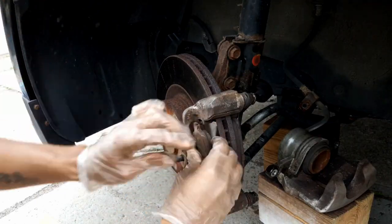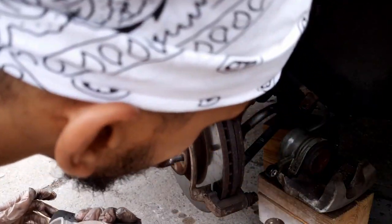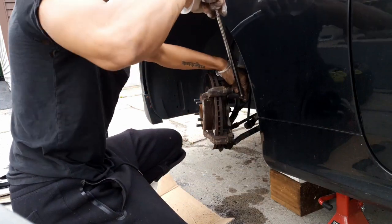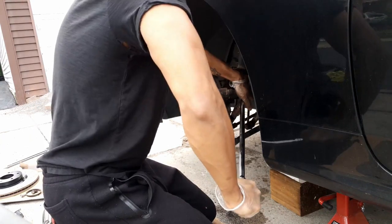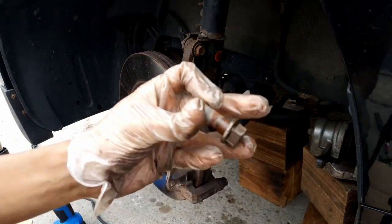Just take a little pick at it, try to be gentle and take it out. Then finally you want to take your hammer and bang the backplate, because this is seized on — this is what four years of neglect looks like. Grab your 17mm bolt and you're gonna struggle exactly like I did, switching through PB Blaster, breaker bar, and hammer. Eventually I pulled out the impact driver and got the bolt out.